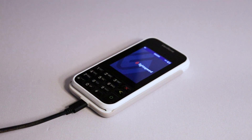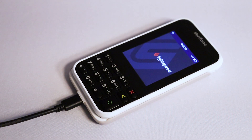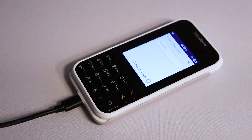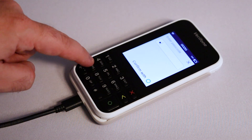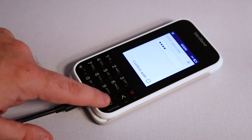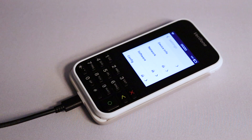If you need to change your Wi-Fi connection or access any of the terminal's other settings, press 9 on the keypad followed by the green circle button. You will then be prompted to input the admin code for your terminal. Lightspeed-provided terminals use the admin code 5773. Type the code using the keypad and then press the green circle button to confirm. You will then have access to all of the terminal settings including network and device info.